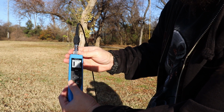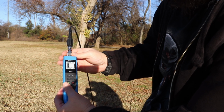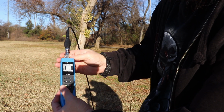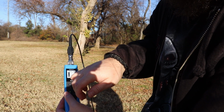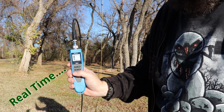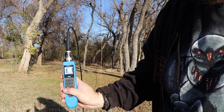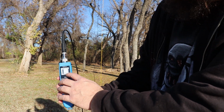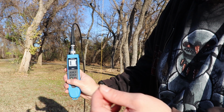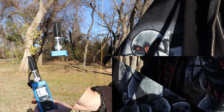Ooh, that's better. I am 1.1 at 14.1. I'm liking it. I'm going to move it another inch or two to see if I can move that graph a little bit more to the center of the band. Ooh. A little too much. I want it to be more in the center. So I'm going to bring it out about 1 inch. And we'll test it again.